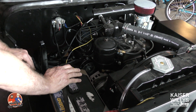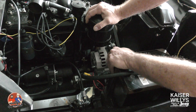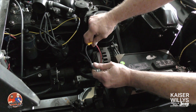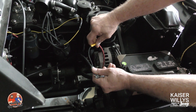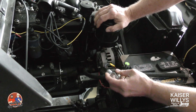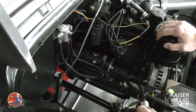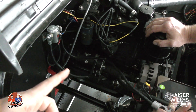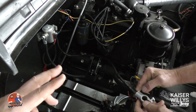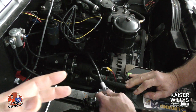Now looking at the back side of the alternator, one of the first things we did was replace the battery cable so it has a lead coming off of it. There needs to be a wire that jumps over to the alternator — there's a single post back there, which is the charging wire that's going to charge your battery as you drive. This cable runs back to the solenoid on the firewall, mounted on the stud for the power side. That's the first thing you have to do: upgrade to this type of battery cable.